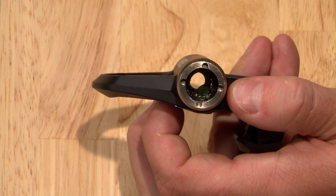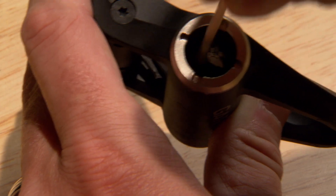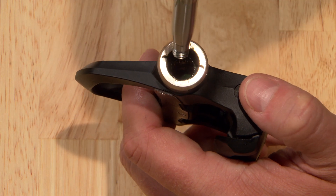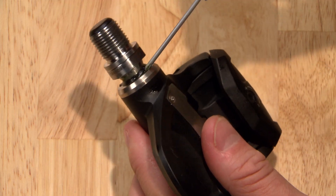Apply a good bit of grease to the bearing and push it into the bearing with a cotton swab or your gloved finger. Then add a little bit along the spindle. Insert the spindle into the pedal body. Press the outside seal flush to the pedal body.